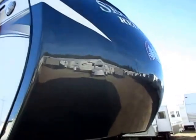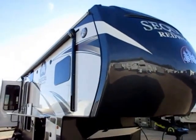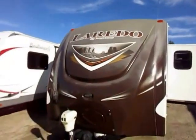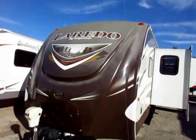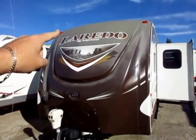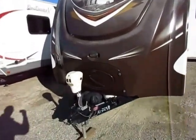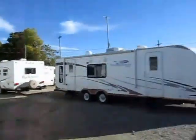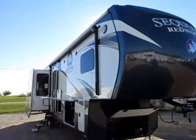We have front and rear caps, and these are fully automotive painted. Once you get close right there, you can see the difference between just a color infusion and a paint. The benefit here is that a paint's not going to sun fade really badly. If you look at this cap over here, you see how badly chalked that thing is? This trailer's only like 2 or 3 years old. The sun has just cooked the cap. If you color infuse a cap, you get this kind of fading. You see how light it is down there versus dark down there. That's what happens if you're not careful. Just to give you a close-up view, normal, nice looking, and then faded like crazy. This isn't going to happen. This trailer's not going to fade any more than your car would. And if your car is 20 years old, you'd expect to measure some sun fading.